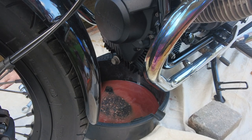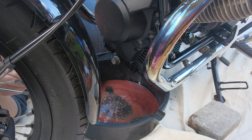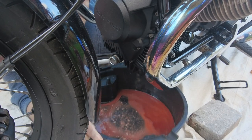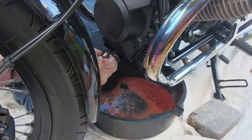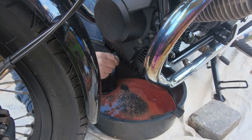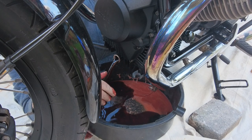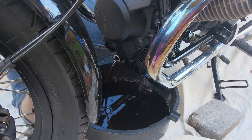I'm very carefully going to try to remove the first sump plug without burning myself. It doesn't want to come off — that's cracked it. It should come off with the open-ender. As I said, the exhaust pipes are still very warm and easy to burn. Point of no return — here we go. And I forgot to put my gloves on. So that's all coming off and looking not too bad.